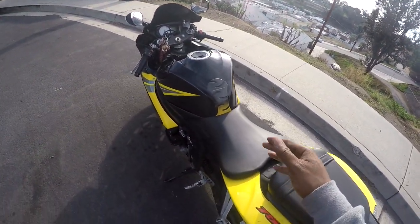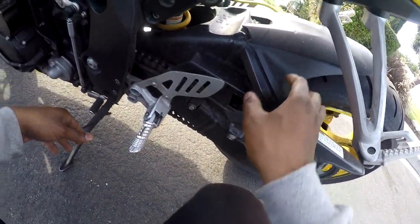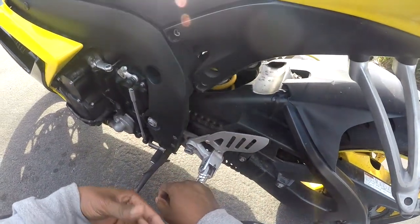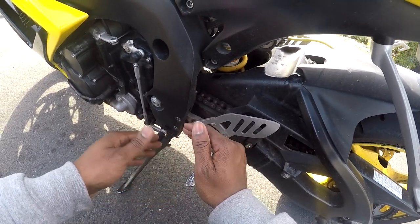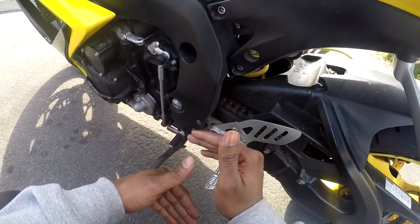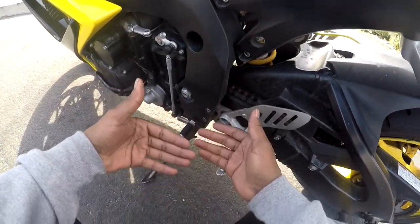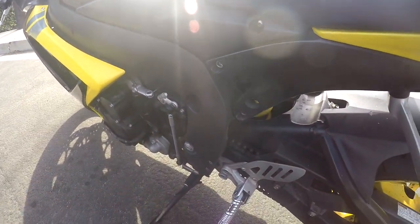As far as the gear shifter goes, my bike is really dirty. I was riding in the rain, it's okay. Anyway, the gear shifter goes basically 1, then neutral, then 2, 3, 4, 5, and 6. Think of neutral as being between gear 1 and gear 2. Every bike starts off in neutral. When you park a bike or when you're at a stoplight, most people are in neutral, because you can fully let the clutch out and just chill when the bike's in neutral.